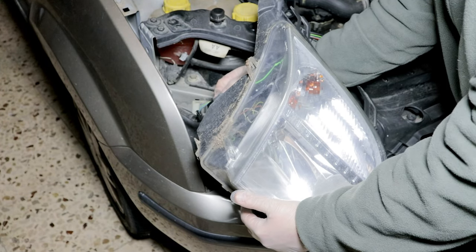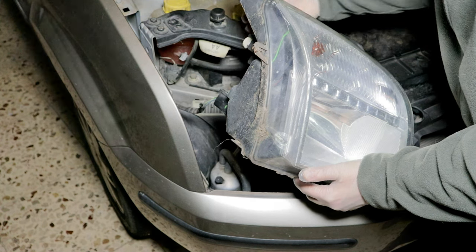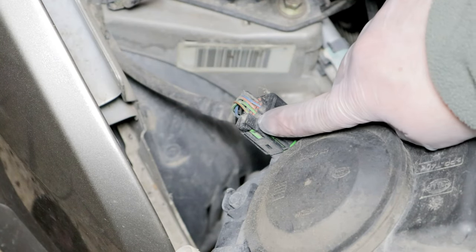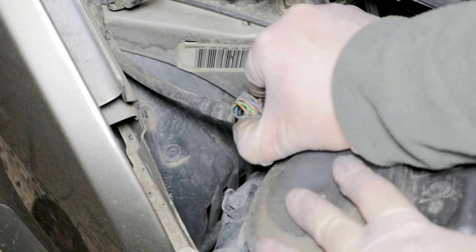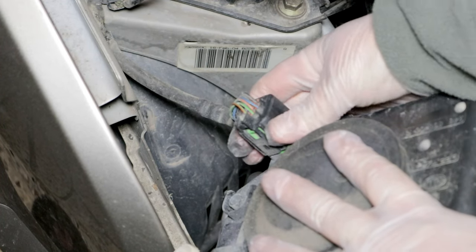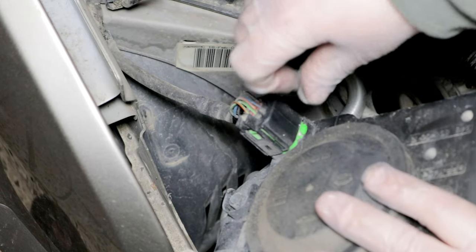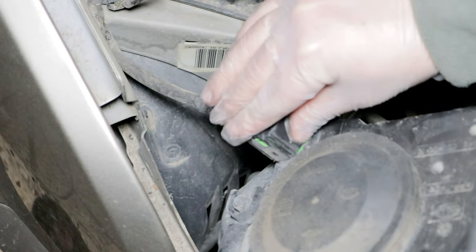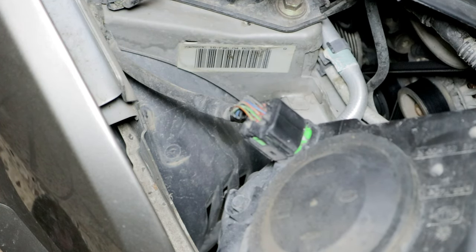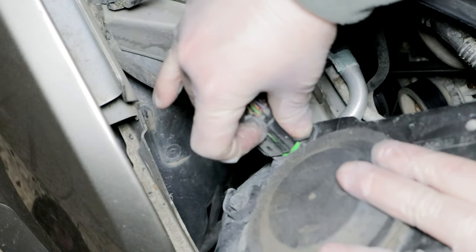In fact, in addition to the planned replacement of the bulb, I had to insulate electrical cables with a crushed sheath and weld a plastic support of the broken light. The main cause of premature deterioration of light bulbs is overvoltage and voltage fluctuations, for example when switching the vehicle on and off, but also vibrations of the light in incorrectly insulated cables can significantly reduce its operating life. Therefore it is always advisable to restore the light as much as possible to its original conditions in its entirety.